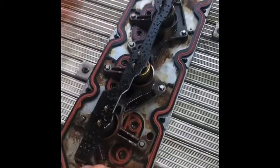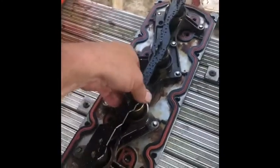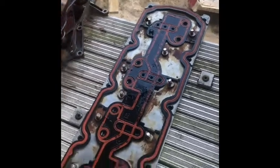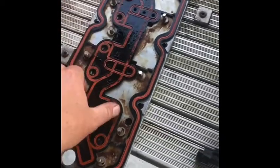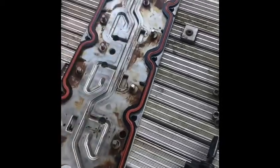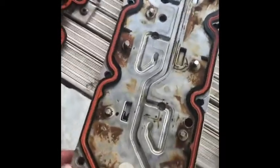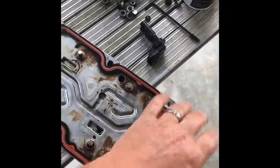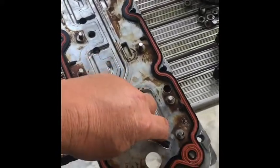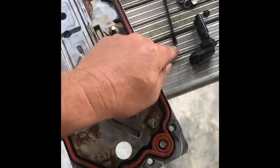I cut these off with my cutoff tool and removed these solenoids, then cut this gasket with a chisel because you won't need this — but you obviously have to have this gasket. Once I got that off, I tapped this passageway right here and I'm going to use a set screw. You don't tap that hole all the way through because you want this to tighten up in there.